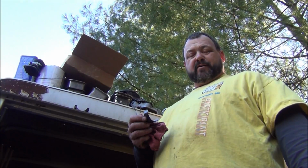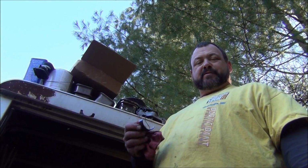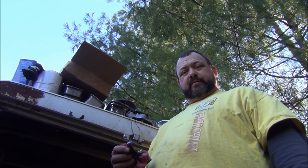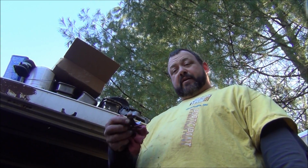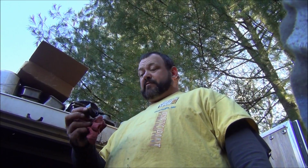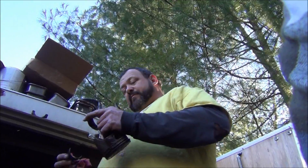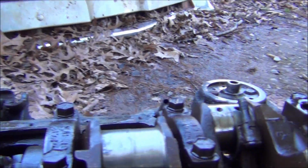I mean, if it makes a place on a crank like that, you're gonna take a crank out of it. You wouldn't just say, well, I'm gonna get a 20 under bearing and stick beside that 10 under bearing or the standard. Maybe these are 10. I don't know. It looks like it's a 20. So if that doesn't stand, I got a 20 right there in that box. Well, I'm just saying, if that's a standard and it's a 20, it spun a rod bearing, they put a 20 in it. Just look this number up and see what that thing is. Oh, well, let me go ahead and take the rest of these out. What the hell? Ain't no stuff like that.